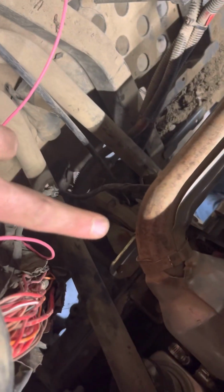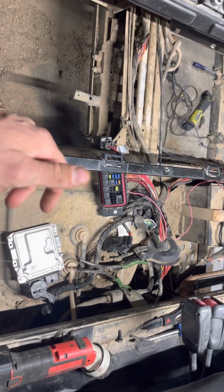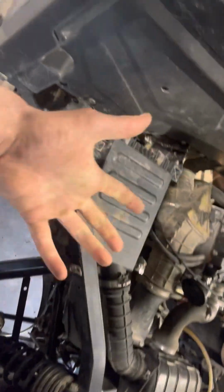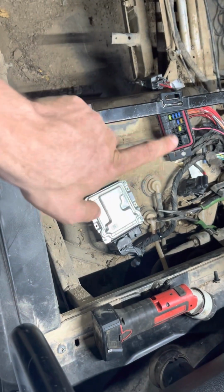now on the diesels, it's down here, if you unplug your thermostat, your fan will automatically kick on with the key on. Automatically kick right on. And if you unplug that, and also it starts working, and it's not, your temperatures are really, really funky on your screen. And I also took a temp gun and put it right beside the thermostat housing and made sure, all right, yeah, that's good. Okay, so your thermostat's working and your relay is good because you can jump across it and it's working. And I've swapped them out and everything like that.